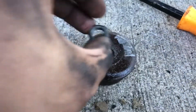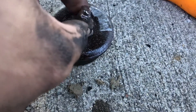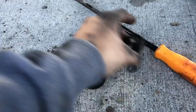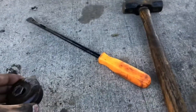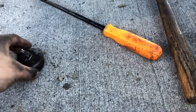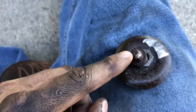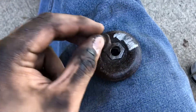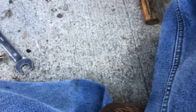Here's a better look at what I did. This is the top of your shock mount, your stock shock mount. You can see where I cut it with the hacksaw. Cut it off, get this big chunk off — cut as close as you can. Then with this last little piece stuck up in there, I just took a pry bar and a hammer and hammered it until it comes loose. Normally the Fox shocks have a hex you can put in there to keep the center from spinning, but these stock ones don't. The vice grips were just marring it up and kept slipping, so I got tired of fooling with it and just cut it off.